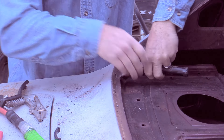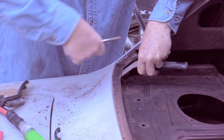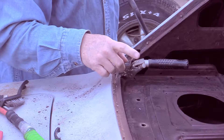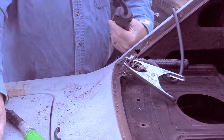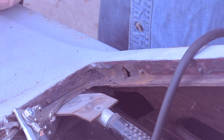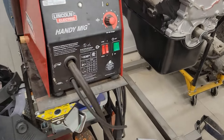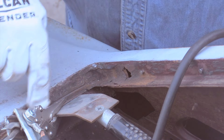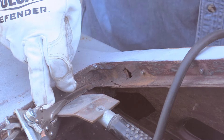I'm going to clamp this in — it's basically a heat sink. I'll also use this for my ground. This is always kind of tricky because I don't know that that's really 24-gauge steel, but 24-gauge is the lightest this MIG will do. On my MIG welder — one of the little pocket MIGs, the Handy MIG from Lincoln — I've turned it all the way down to four with the switch settings on low and one. I'm going to weld this and then grind it flat so the weather strip sits in that channel better.